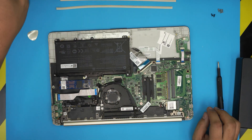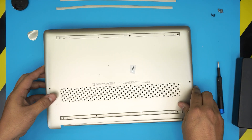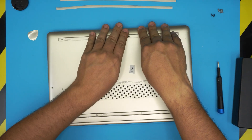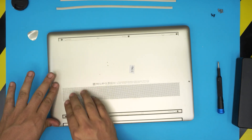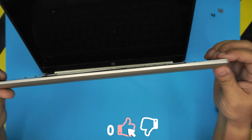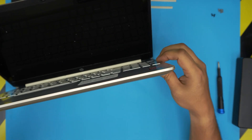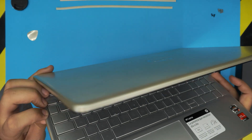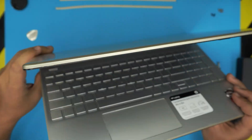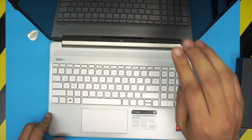Once the battery screws are in, grab the top cover and bring it over. Push down the corners really hard until you hear clicks, and go all around. If you see any gap opening, pinch and squeeze it hard and it will snap right into place. Do this at the back corners and by the USB area as well. Open the lid slightly and squeeze the back edges together to make sure everything is fully snapped in.